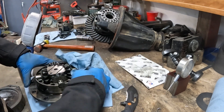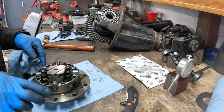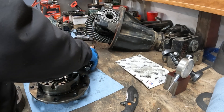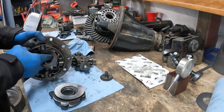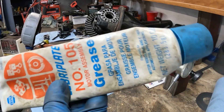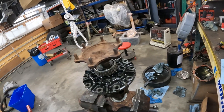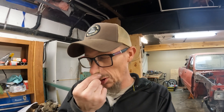At that point the assembly is done. I need to put some assembly lube in there and lube everything up and put it back together. Quick recap: I set up the preload — it's kind of tricky — and with the grease and everything, that ended up giving me about four thousandths of pinion carrier preload per side. The breakaway is now actually quite a bit higher. It's kind of an unscientific method, but you saw what the effort took before — and now the breakaway is very, very tight. I like that.